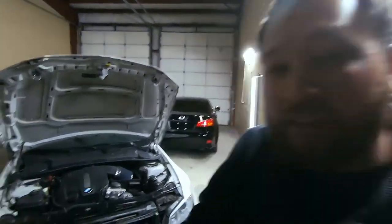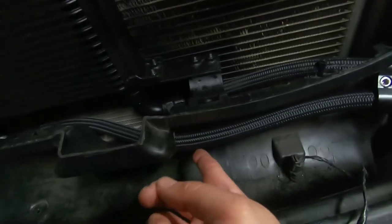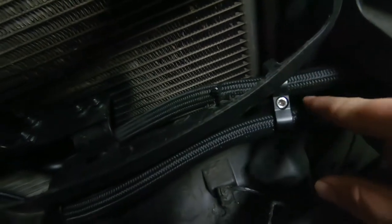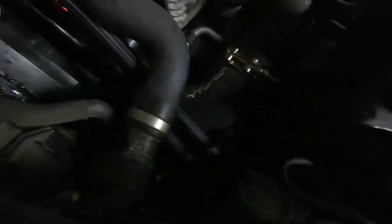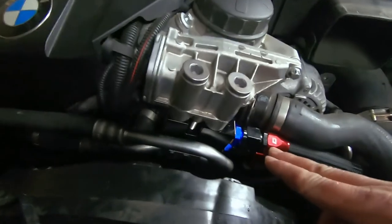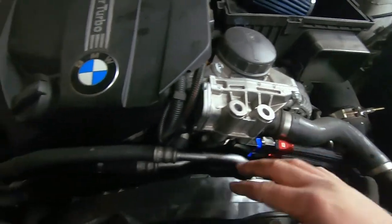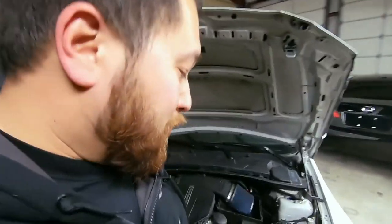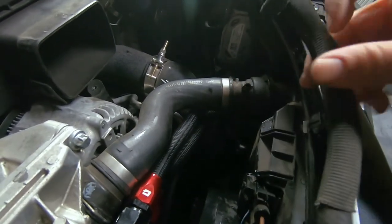Alright, so I finally got the oil cooler fully installed. As you can see here I got it mounted and it's nice and solid. What I did with the oil lines is I got them running through here and I just cut a hole right there for this line to come out. For the other line I got another hole right here cut. And I zip tied it in place so they won't rub on anything and nothing's going to rub through. And then I just had it come underneath the headlight and go into the little cavity here, then came up right behind the headlight unit and plugged into my little adapter. The adapter was a little bit of a pain to screw in there. I did have an AC line that comes across here — I had to relocate that because it was in the way. But I had a little bit of a problem: on my upper radiator hose there's a little nipple here, and this line decided it wanted to break off. So next video I'm going to have to fix that coolant leak.